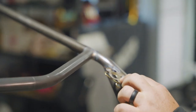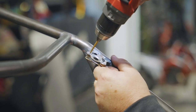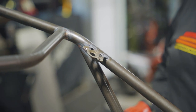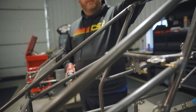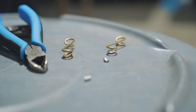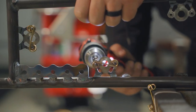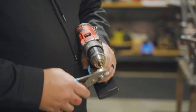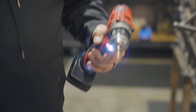Just with an eighth-inch drill bit, we'll drill out every one of these. That's one gone — now we've got to do a bunch more. Before you can pop these back on, you've got to get all those little pieces out because you can't pop them that way. We'll show you the easiest way to do that too. One of the bigger pain in the necks when you're drilling all these out is you end up with the heads of all the rivets on your drill bit. A little trick: just grab it with a pair of pliers, run it in reverse, and it'll walk them all off. Now you're ready to drill a couple hundred more.